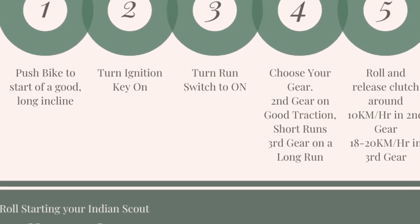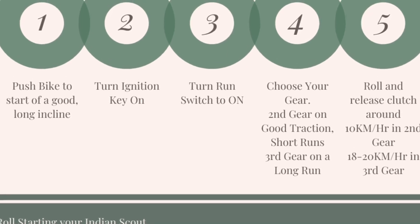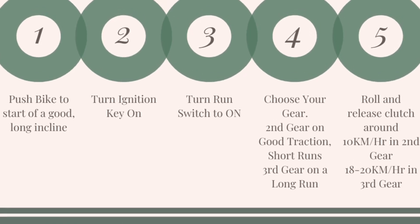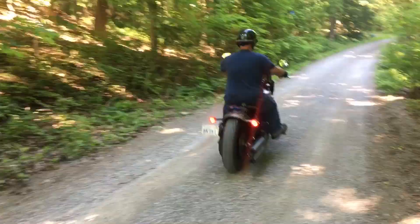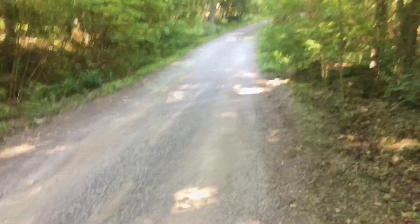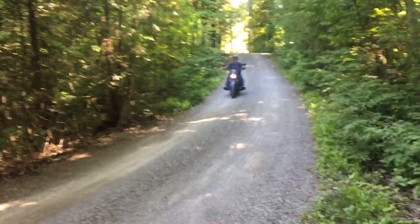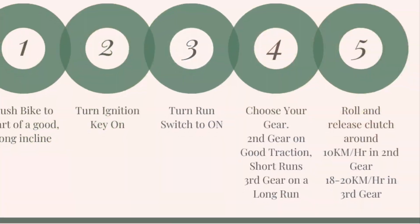Next, pick the gear you're going to use. Second gear is the best for low speed, and in an emergency if you don't have a very big hill, second gear might be most appropriate since you won't be able to get the bike going that fast. However, as you can see going down this hill with loose gravel, my back tire locks up repeatedly. I do finally get it to fire in second gear, but the tire locks up four or five times. When I do it in third gear, I just let the bike roll, it gets going fairly quickly, I pop the clutch, and it fires up immediately.